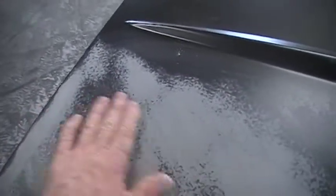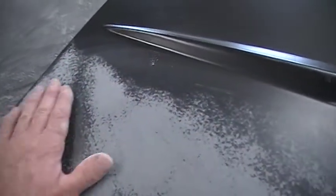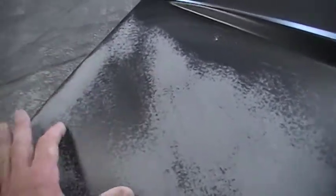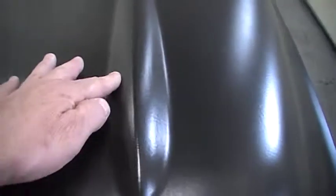That's an obvious low spot — I have plenty of material here to work to get down to that. According to their guidelines, if we don't get down there, this does not have to be re-sanded; you can spray over this. So we can spray that filler in here in the future if we don't knock all that down. I'm very hopeful this is a good material. It'll save us a lot of time between the epoxies and 2K primers that shrink. This is supposed to be a no-shrinking type primer.